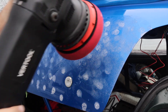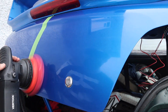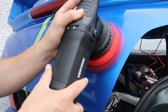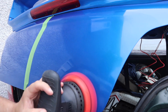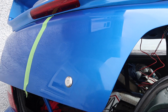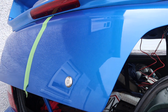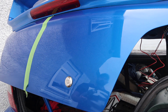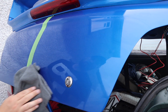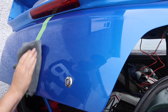Time to finesse. After doing that second pass with the medium cut compound I was really happy with how it was coming up. Time to use the finishing compound to get the panel looking as good as I can possibly get it. I did put way too much polish on the pad - sometimes I forget I'm doing a small area. After one pass of the finishing polish, I'm using a little bit of Garage Therapy panel wipe to get rid of any polish residue, and then we can go in for a final look.